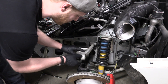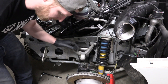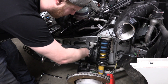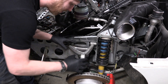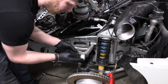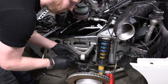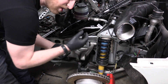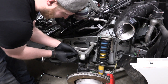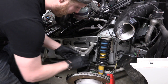It was a little bit troublesome getting this bushing back in here but I finally did. This piece is still hot. What I went ahead and did was I took the blowtorch and heated up the outer part, this aluminum part. Aluminum dissipates heat really well and heats really evenly, so you can heat it in this area and it'll end up heating this whole collar. I heated this up — that'll expand it a little bit. Hopefully the piece of steel inside won't heat up as fast, making this a little bit bigger than normal. Then I stuck a collar around the outside and just hammered it over, and that actually got it to scoot over nicely back to where it goes.